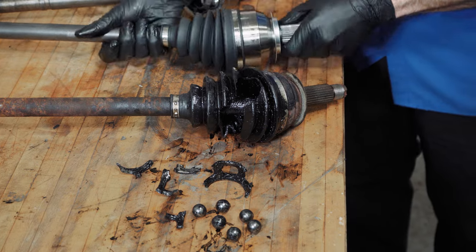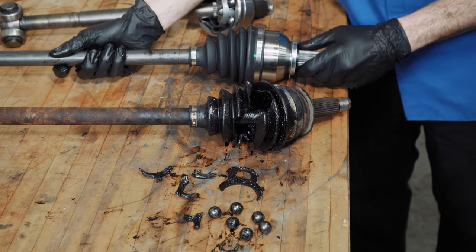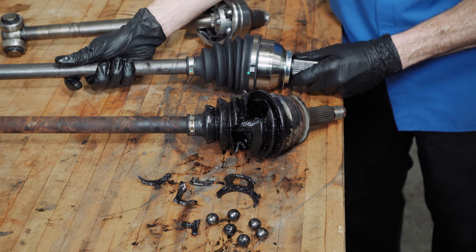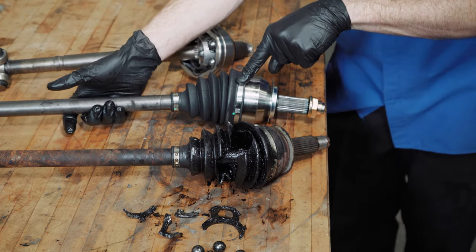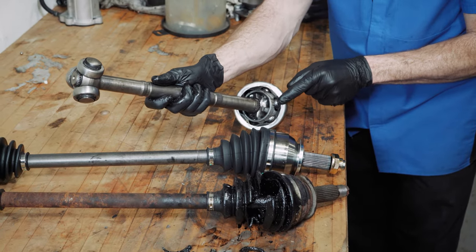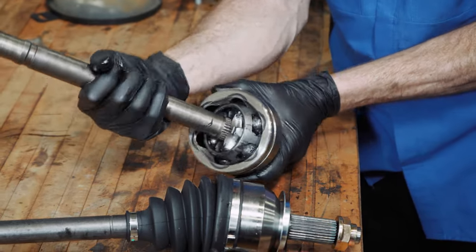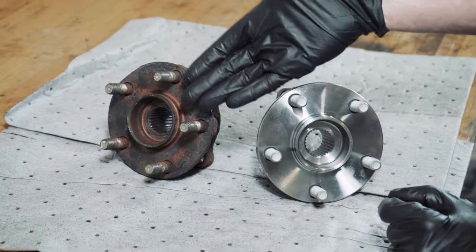There should be a boot protecting all that. While you're driving down the road, the axle will be spinning very fast. At the same time as it's spinning, it should be able to pivot up and down a little bit with the suspension and be able to turn while you're making corners — all while rotating — so there needs to be lubricant on the inside to lubricate the ball bearings. This is another axle, a little bit different, but it's already taken apart so you can see exactly what's going on inside. We have the caged area that's supposed to be holding each one of those ball bearings in place. This should be able to rotate and keep constant velocity while you're driving.